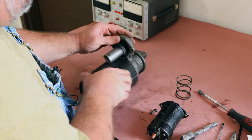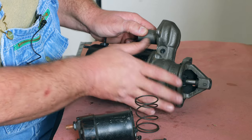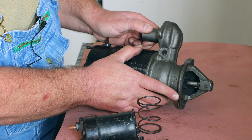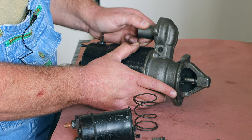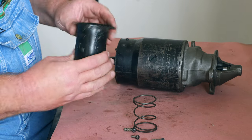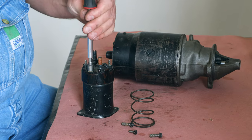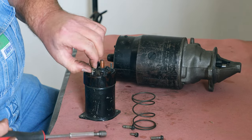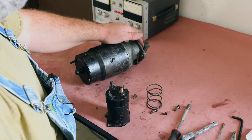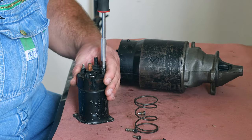The spring. What the solenoid does is it engages the gear that would be engaged into the flywheel, and that would be the retracted position. So that's one part of what your solenoid does, it engages the starter drive. The other thing your solenoid does is here at the back, and that is it switches power to the motor. And it should switch it in such a way that this is engaged fully with the flywheel, like that, before the motor is energized.